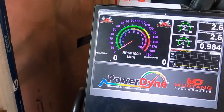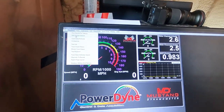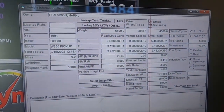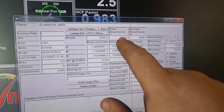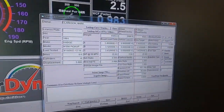We got the truck strapped down now and we got to load up the dyno. We got our weights in here — 91 Dodge W350, 6,500 pounds. Driven wheel weights are around 2,000 pounds; undriven weight is everything else. The driven weight is how the dyno loads the load cell — your wheels, tires, brakes, axles, drive shafts, everything like that.